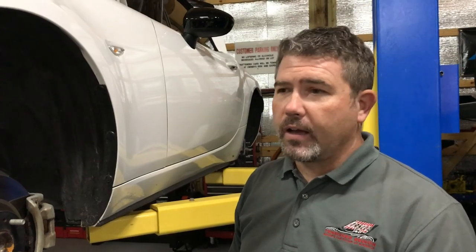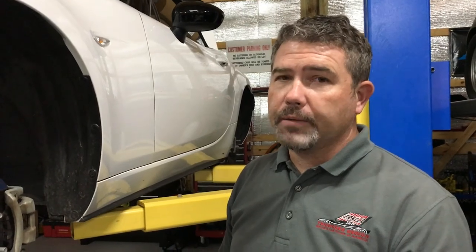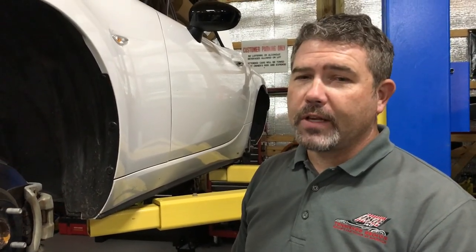They are reworking those shocks. They're increasing the body length 1 inch and the shaft length 1 inch. So they will be pretty much right on with the OE Bilsteins. And hopefully we'll get those back in a few days and get them on the car. In the meantime, I'm gonna stick the Bilsteins back on the rear so we can get the car lined up this weekend. But it'll have JRIs on the front and Bilsteins on the rear for now.